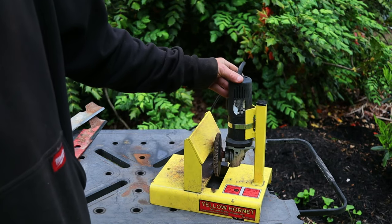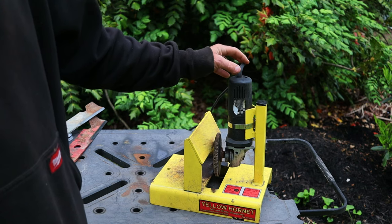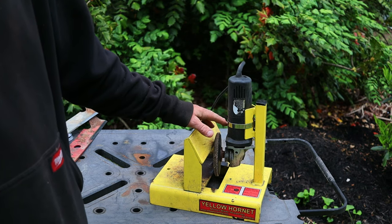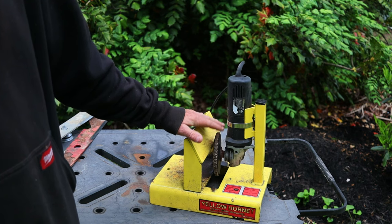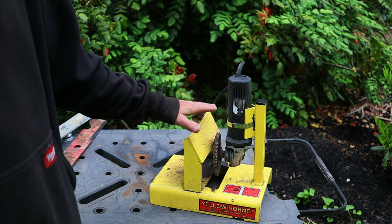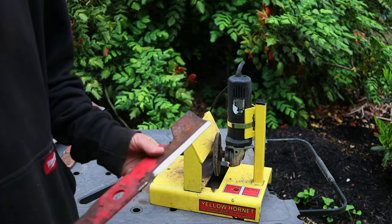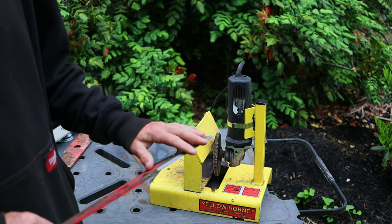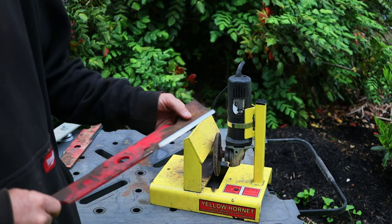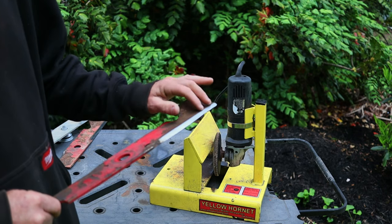What I have here is a Harbor Freight angle grinder — about $15 — with a really high-quality flap disc. This flap disc makes all the difference when using this setup. It gives great results, cleans the blades up nicely, and hits the blade perfectly compared to a smaller flap disc where you have a lot more misses when trying to grind the blade out.